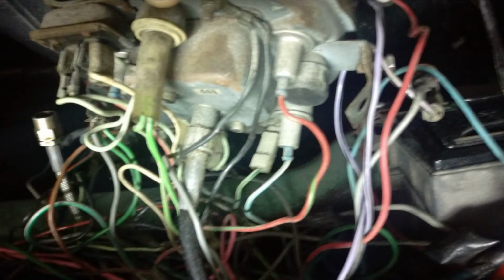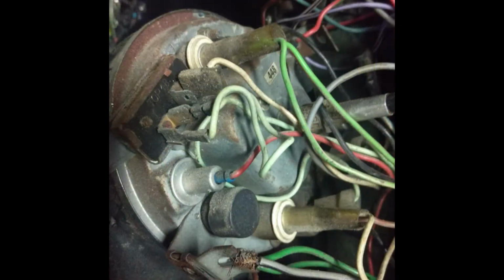Now on to the thing I've been dreading. How this car has not caught fire yet is beyond me. There's no less than 10 exposed wires going God knows where, just stuffed underneath the dash. If I put my hand in there, stuff just shuts off or turns on. Sometimes the wires are just loosely wrapped around contact points. There are multiple ground wires tied to other random ground wires using masking tape and hope. It's a rat's nest under there.